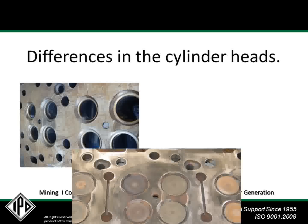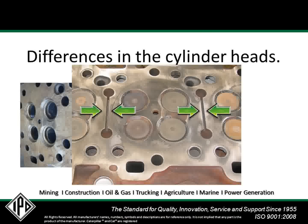The later cylinder head castings had a relief cut or groove between the cylinders, as shown in this second photo. This cylinder head design was typically used with the later engines and with the heavier five-layer style head gasket.